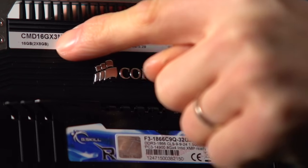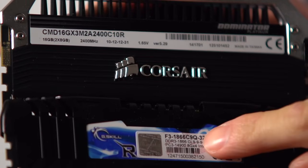When shopping for computer memory there's all kinds of specs to pay attention to, including the frequency, the timings, the voltage, and how many sticks actually come in the kit, and how many channels it's rated for. You can usually tell by the little number on the memory itself or on the box showing you how many pieces are intended to be in the kit — that's normally how many channels it's intended to be operated in.